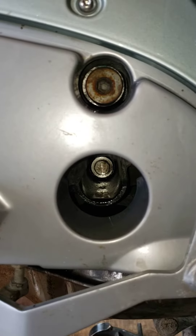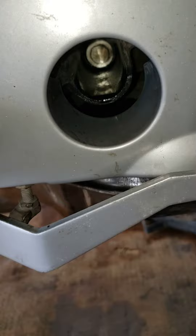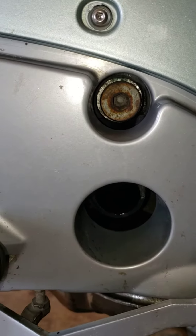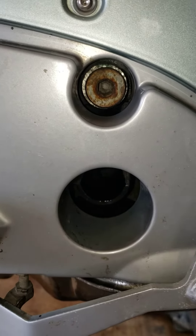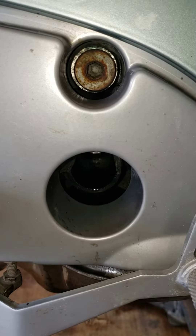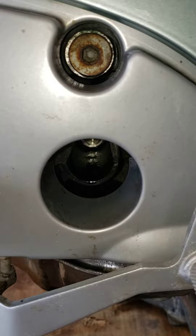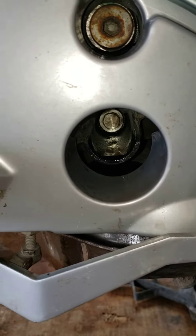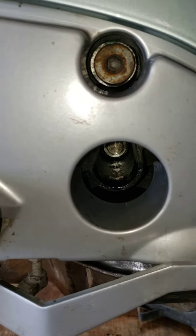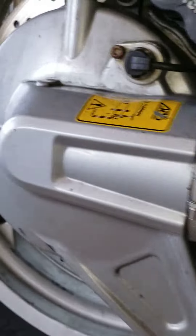Make a little cardboard extension to get the oil to come out past the little chute thing and drain into a bucket. There's an 8mm socket on the top — leave the top one in so the oil doesn't come gushing out. If you take that out while it's hot, it's gonna gush right out and go all over the place, so leave the top one in.